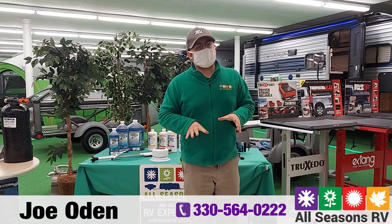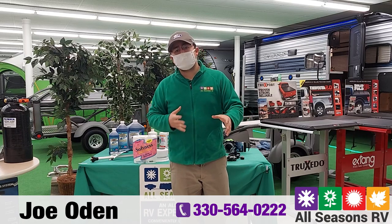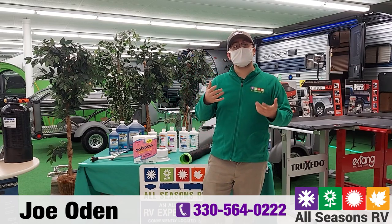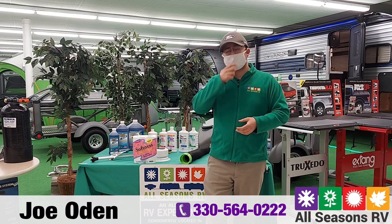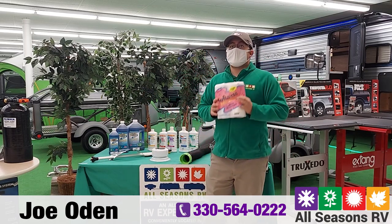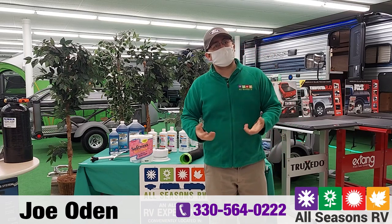Lastly, make sure you're using RV safe toilet paper with your RV holding tank system. Some people think septic tank safe toilet paper is okay — it's really not. The true test is to set a square in a glass of water: if it dissolves into a pulpy, mushy material in about 30 seconds, it's fine. If you can pull the full square out intact, it won't work for RV use — that's when you get tissue buildup and potential clogs. Any RV dealership sells RV safe toilet paper in two-ply or single-ply. Avoid things like Cottonelle or Angelsoft 10-ply, which will cause more problems than good.